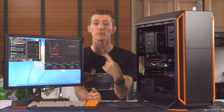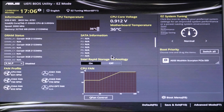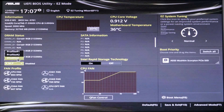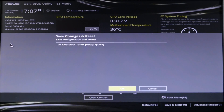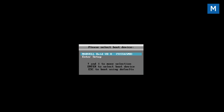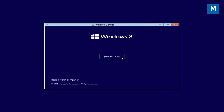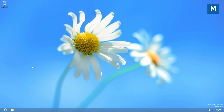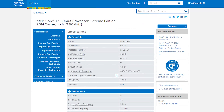The Scorpion PCIe SSD comes pre-configured in RAID 0, so you can skip the CTRL+M menu during boot and just press Delete or F2 to get into the UEFI BIOS for the X99-E WS motherboard. In easy mode you'll find fan RPM monitoring, boot priority configuration, and XMP configuration — set XMP to profile 1 to ensure your RAM runs at the right speed. We won't be doing any overclocking given the cooling fans we've removed. To install Windows, create a bootable USB drive and reboot while mashing F8 to get to the boot device selection menu. Drivers can be found on the ASUS, NVIDIA, and Intel websites.